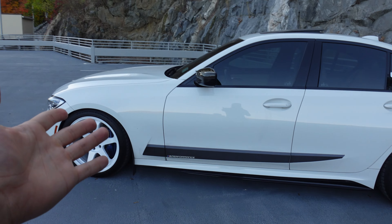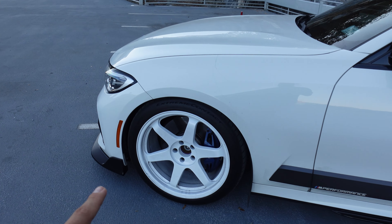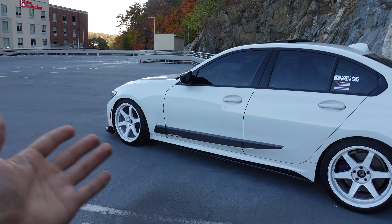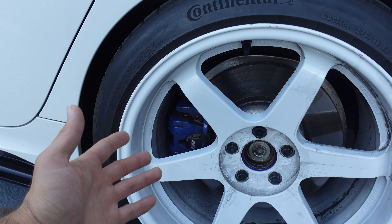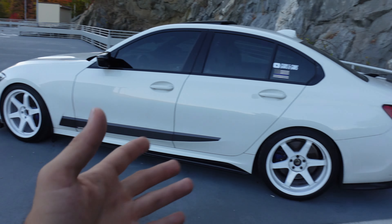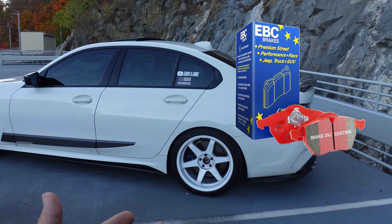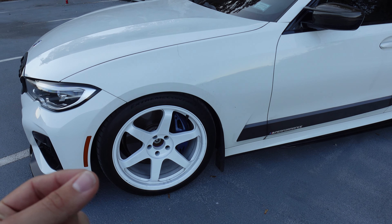When you modify this car to 500 horsepower, the brakes are only rated for the stock 382 horsepower. A major problem on this car is brake dust — if you own any semi-modern BMW, the crazy amount of brake dust means that with white wheels like mine they would literally look gunmetal gray without aftermarket brake pads. The rear brakes are only one-piston, which is crazy for a 500-horsepower car, with four-piston in the front. For better braking and to reduce brake dust, get something like a ceramic brake pad. EBC makes good ones for these cars. I personally have Power Stop carbon ceramic brake pads and they help the car stop way better. Aftermarket brake pads are a must just to get rid of the horrible brake dust issue.